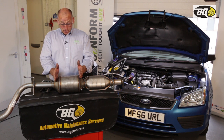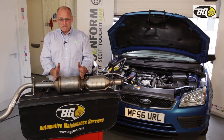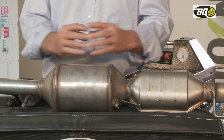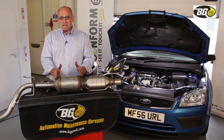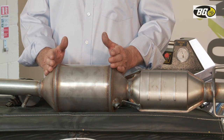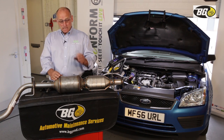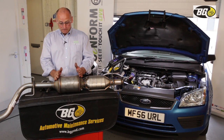The construction of the DPF is quite important. The catalyst is built on a silicon carbide substrate in a honeycomb formation, coated with aluminium oxide and cerium oxide, which is porous. It's porous to the gaseous parts of the exhaust stream — those gases of small molecular size will pass through the porous part of the DPF into the atmosphere.